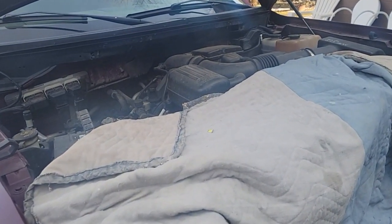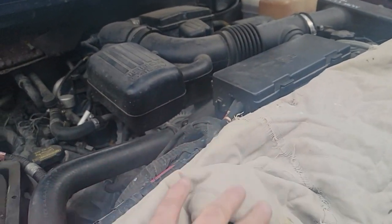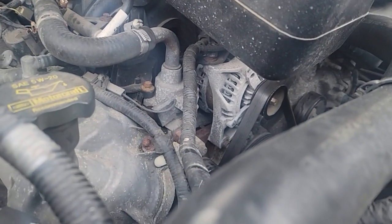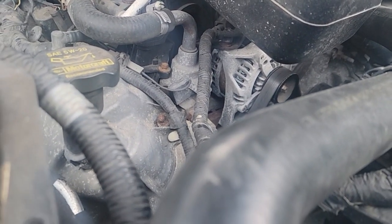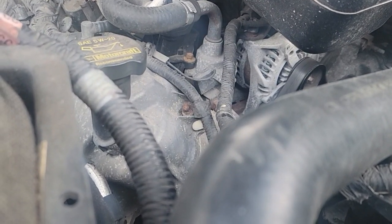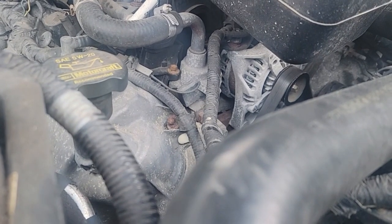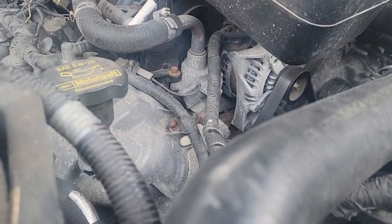Welcome back. We're on the 2010 F-150 with a 5.4. We've got that alternator squealing sound. I put a long screwdriver up to my ear to confirm the location and it makes a noise on the alternator. Sounds like a bearing. It sounds like it's running dry. Now, I replaced this alternator, I believe, like four times now.